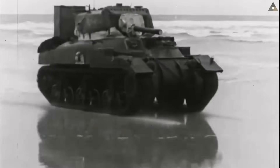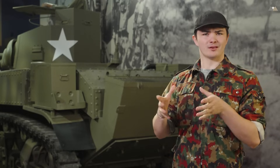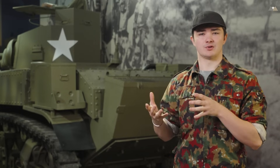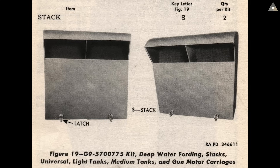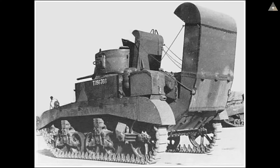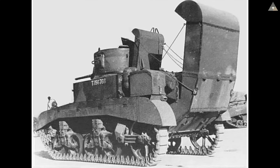Without proper procedures and equipment, water can not only leak into a vehicle, it can drown the engine. Fording equipment kits not only make the vehicle's hull somewhat watertight, but they also include chimney-like things called stacks by the U.S. military. Stacks are designed to stick out above the water, so like a human snorkel, the vehicle has a way to breathe, so to speak.